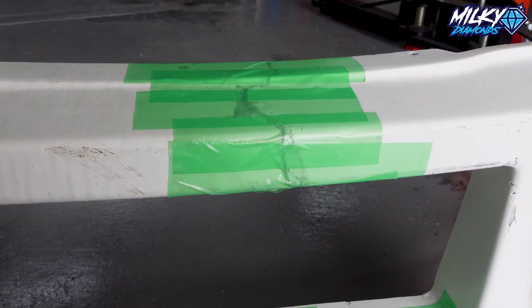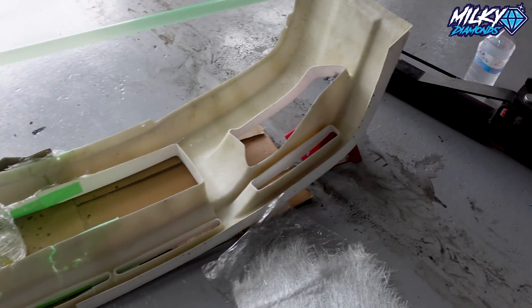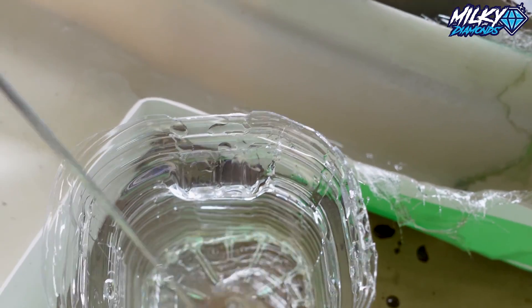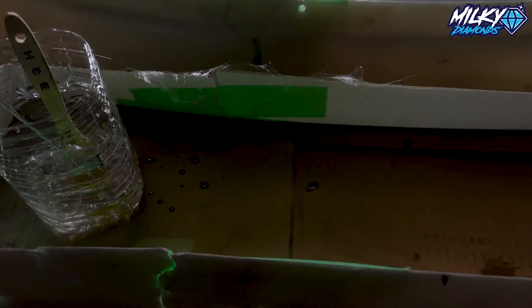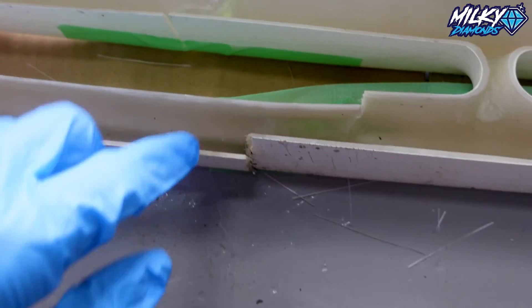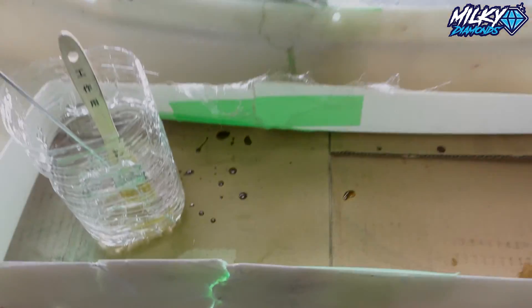This is just to hold it in place while I go mix up the resin for the fiberglass. Got some help from James — he made the mixture for me. I have no idea what the percentages are, but he told me I can't take too long or it'll harden up. He did the top part for me using some chop strand, and then Jono came just to measure the bumper to make sure it was the right width for my car. Here's the chop strand — I've got to do the next two parts: the part that goes the whole way down and the part at the bottom.